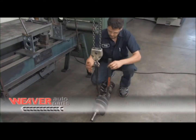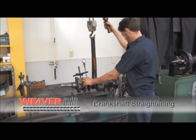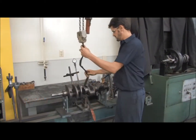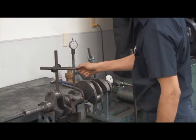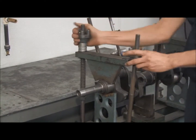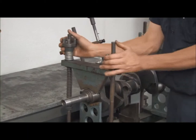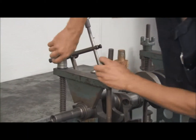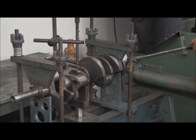After the crankshaft is cleaned, the crankshaft is placed on a straightening device with V-blocks and slowly rotated to determine the straightness of the shaft. If the shaft is found to be more than one thousandths out, the shaft must be straightened prior to grinding. Straightening the shaft is accomplished by leaving it on the V-blocks, clamping it down, and having a hydraulic ram bend it back into specs.